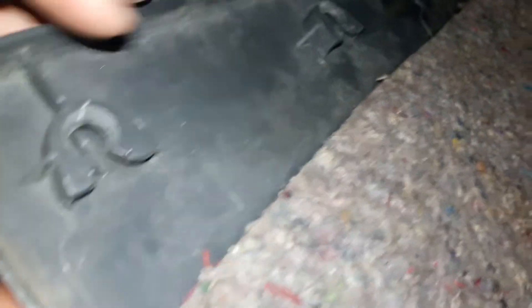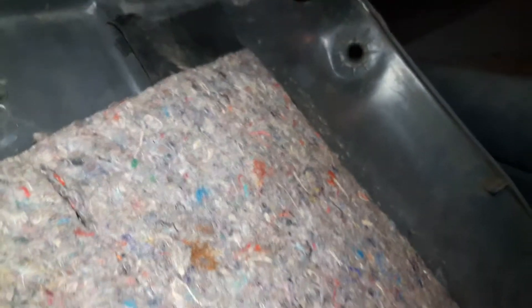This bad boy just pops out. There are some little plastic anchors in there holding it. Pop those out and then it'll be on the harness — you basically yank it up to clear the stalk and out. It's kind of an awkward situation. Here's the spot for all the anchors; it's obviously missing a few. They slide right into these tabs. We're gonna buy some new ones — those are obviously pretty worn. That's where the door lock went through and pulled it out of the handle. Basically the only thing really holding it on now is this wire and three Phillips screws, plus another one back behind here at the top.